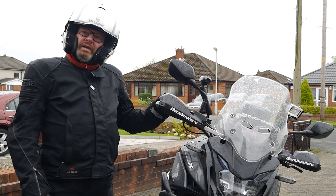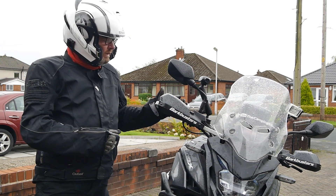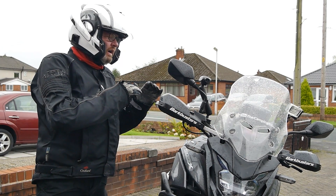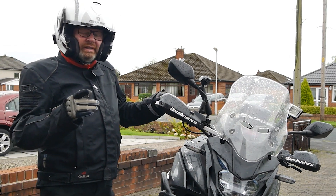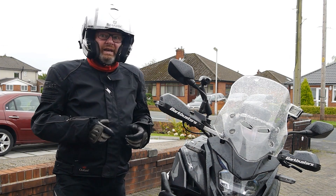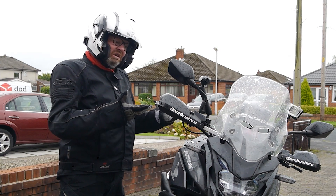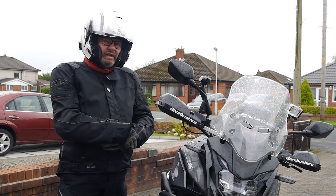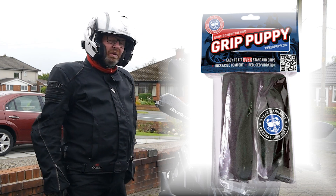So there you have it guys — big success. The vibrations that were getting through the handlebar grips have diminished. Indeed on a test ride on the motorway sitting at about 75, very little in the way of vibration coming through the Grip Puppies. The other thing to mention is — and I wasn't so sure this was going to work — but they say it works with heated grips, and I had the heated grips on to test that, and I've got to say it does work through the foam. So you can still use your heated grips. It cuts down on vibration. Excellent value for money, and it solved a little niggle I was getting on this Honda CB500X. Thanks for watching — thought that might be useful for somebody that hasn't used these before. Pretty simple. Thumbs up.